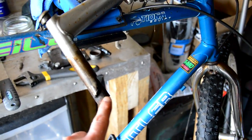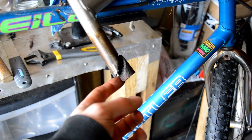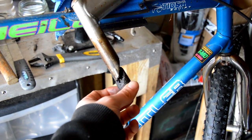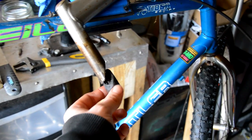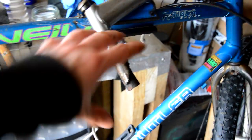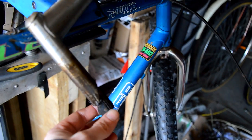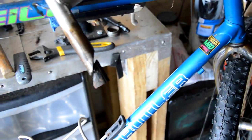I honestly thought this might be the downfall of the bike - this stem. I've had to soak it for a week with the bike upside down and the head tube full of fluid. But it's come free - I managed to get it free. I had to work the bolt loose and I might have to replace that. I'm going to try and clean all this up. It's definitely going to need a lot of grease when it goes back together. But it's free, it's out, so I can continue with the bike.